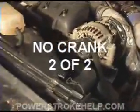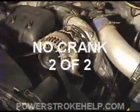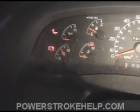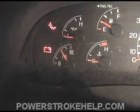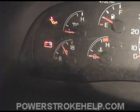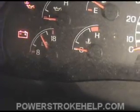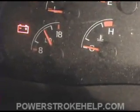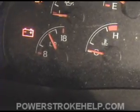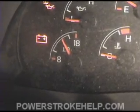First of all, I'm going to show you the legitimate shop way to do this, and next I'm going to show you the old-fashioned shade tree way to check an alternator. Nine times out of ten, when your alternator goes bad, the battery light will come on. But very often what happens is you get an alternator that won't put out as much electricity as it should, and it won't quite trip this light. But you'll notice that your charging gauge, your battery gauge, is going to start to drift down towards the 8. Even while you're underway, this is an indicator that your alternator is not working correctly.